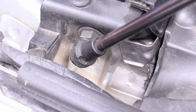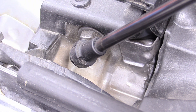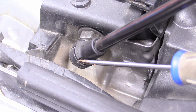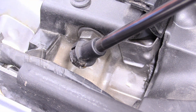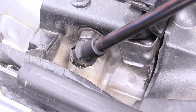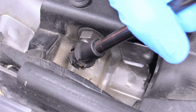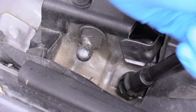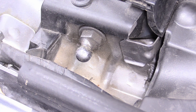What we're looking at now is where the strut attaches at its base, underneath the hood just above the shock tower. Take a small flat implement, wedge it in there underneath that clip, and pry the clip out. Ideally recover the clip so it doesn't rattle around your engine bay. Now the hood strut can come off at the bottom. If it's particularly stuck, you can wiggle the hood up and down to walk it off the anchor.